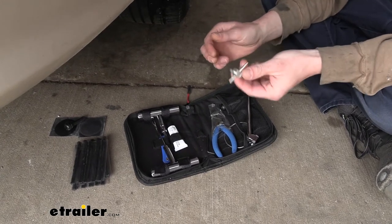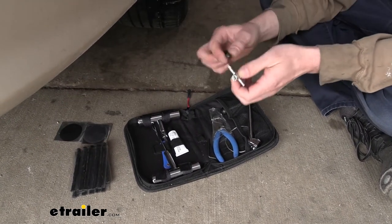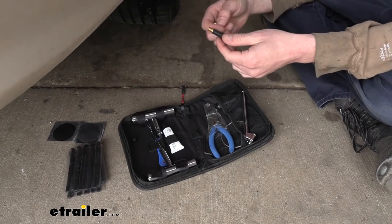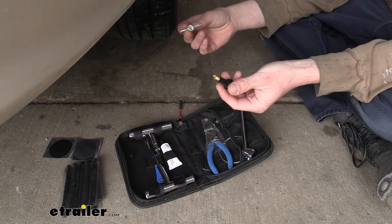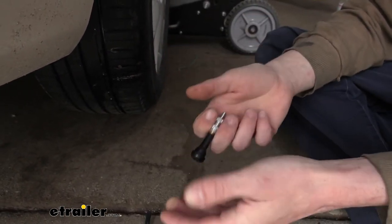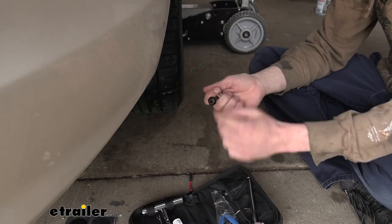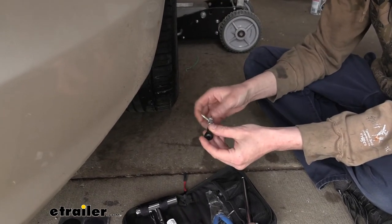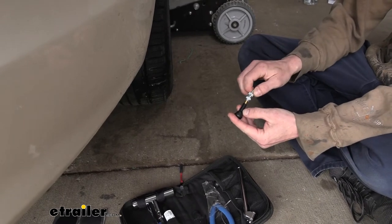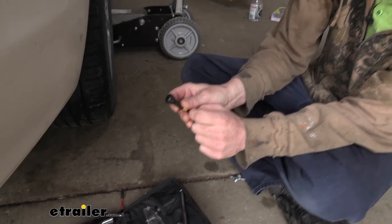Here we've got a valve stem tool. This allows you to remove the valve stem core, and it's also used for installing a new valve stem. For example, if you were working on your lawn mower with the tire off, you'd use this for removal — see how this threads on the end of the stem. You can thread it on and pull the stem right out. When you go to reinstall a new one, after you get the old one out from the inside of the rim, this just slides through. You thread this on to grip and pull the rest of the way so it snaps into place — this area here fits in the groove of the rim between that lip and the fat bulb at the end.